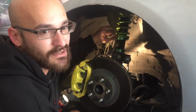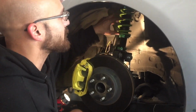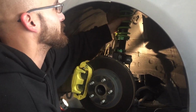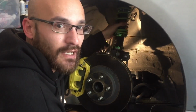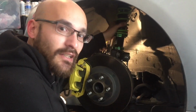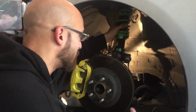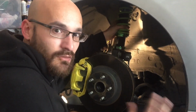According to this being 6 inches, you get, like I said, 1/4 of an inch of preload. So you go 6 inches, a little bit past 6 inches. That's how you know it's tight, ready to go. Like I said, that's already adjusted. We're gonna put the wheel on. We're gonna do the other side, and then give it a test drive. Make sure it doesn't do that clunking or any of that stuff anymore. Of course, check the back too, and then after that, do the ride height.